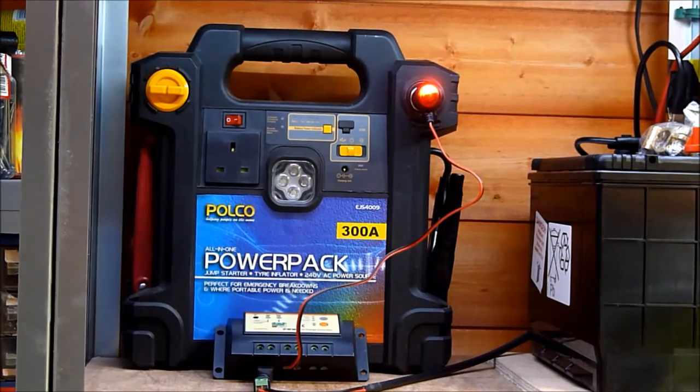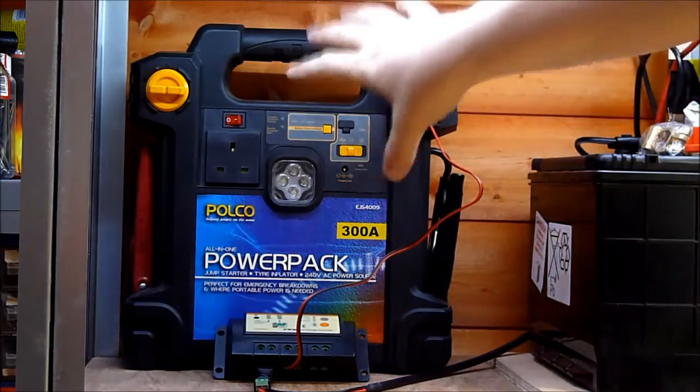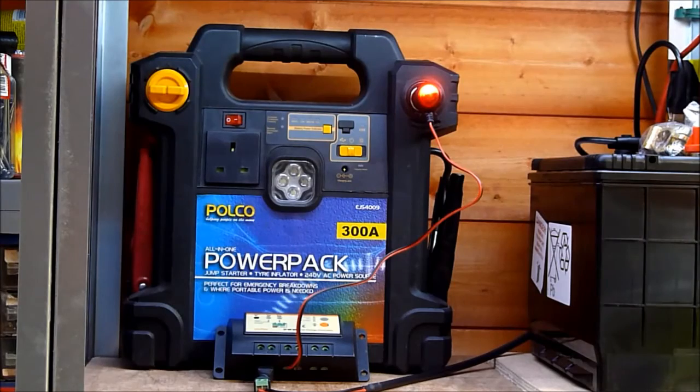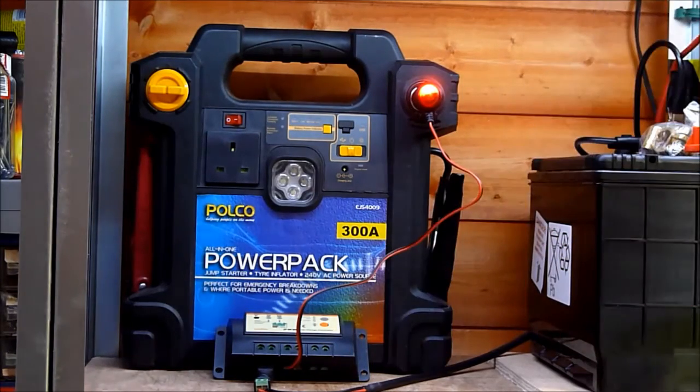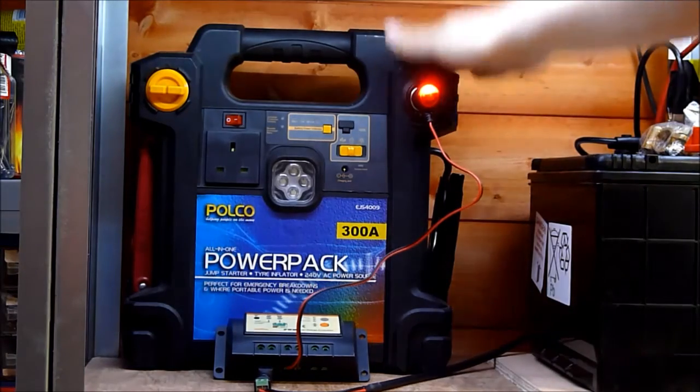The battery's fully charged, so it's fantastic that I've been able to resurrect it. I also thought it's the perfect solution for those starting out with a project like mine — a simple, small solar panel on the ceiling, feeding into a charge controller, feeding into a portable power pack like this. Take your lights off the load on your charge controller, charge up using a cigarette adapter which you can easily unplug so you can move it, and you'll always be able to start your car.